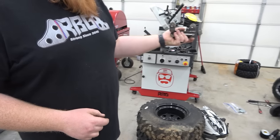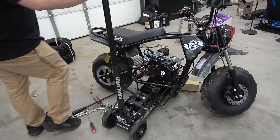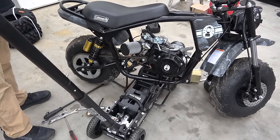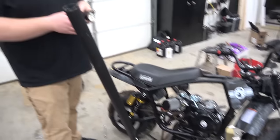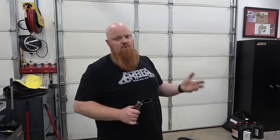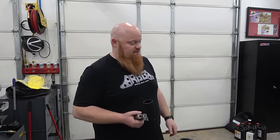So we can bolt this in now and we're done, other than coming up with a gas tank and an exhaust. You can see you can lower or raise the engine once you unbolt that rear mount. So it's actually pretty handy. But it does have rubber bushings in that, and I'm pretty sure, we haven't tested them, but the bushings we sell for the Trailmasters on our website should fit this. We're going to try that out next week and make sure they do. Then we can come out with a kit, basically just add Coleman to the mix of bikes that it fits.